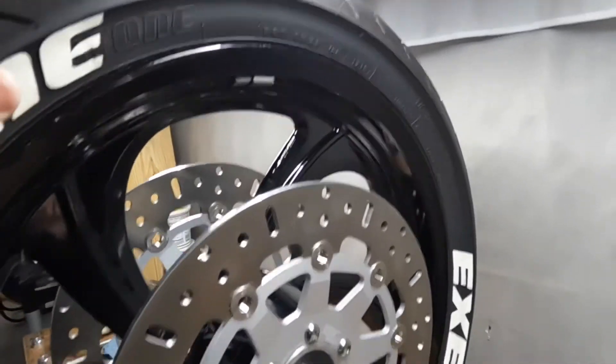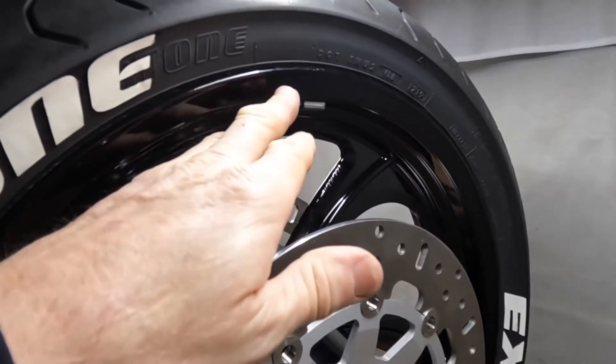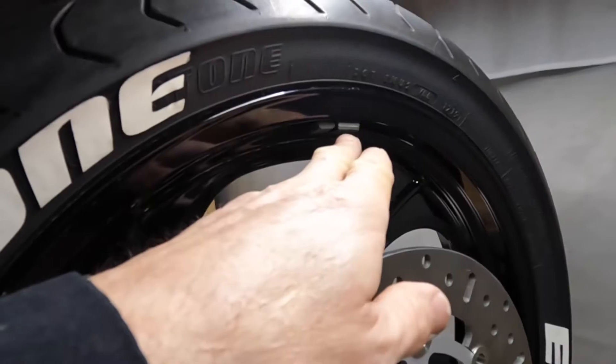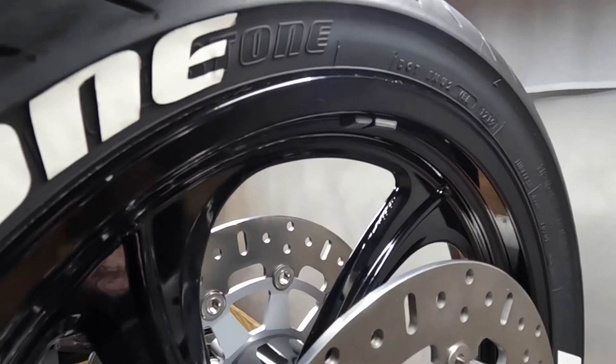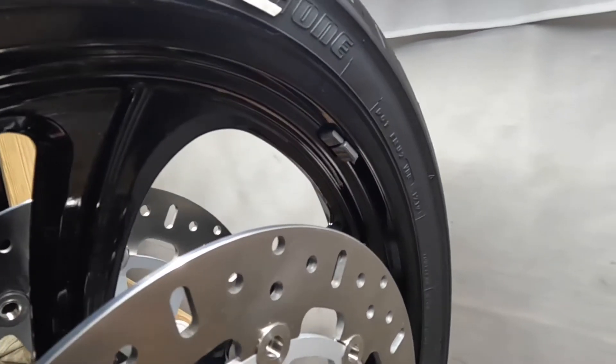When I stopped it, this was the lightest part of the tire. I actually just took some lead weights that didn't have double-sided tape on the back and just masking-taped them up here — it's just kind of an estimate before I started putting lead weights on permanently. I don't love the look of the lead weights, but there's not a whole lot I can do about it.